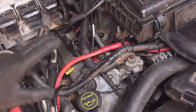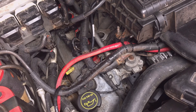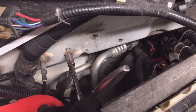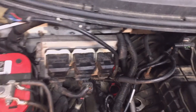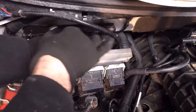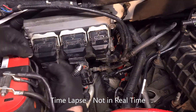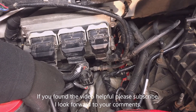The plugs are installed, the coils are reinstalled, and I'm going to fire up the truck before remounting the PCM back on the firewall. It fired up and ran smoothly. I'm going to clean the ground behind the PCM before putting it back on since I have access to it. With the ground cleaned up, it's just a matter of mounting the PCM bracket and putting the PCM back on the bracket. That concludes the video — if you found it helpful, let me know in the comments, and please subscribe.